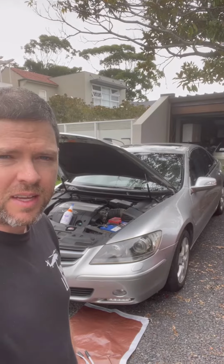Because we're here with old Emma, who's having a bit of a hard time with hard transmission bumps and clunks and slips and stuff. It's nothing terrible, drives just fine, but we're trying to keep it that way. And I've had luck with Lucas products before, so we're going to drop it in there and hopefully we'll have luck again. So what's been happening is if someone shifts the transmission too hard, forward to reverse, gives it an old clunk in, doesn't pause in neutral or lets it shift against a roll or something like that, then do that too many times and we get a warning come up on the car, and it looks very dramatic.